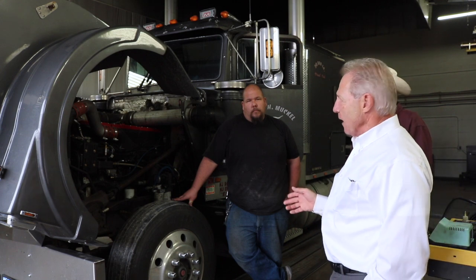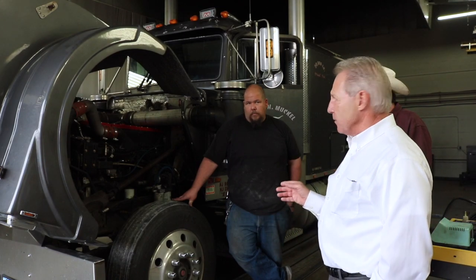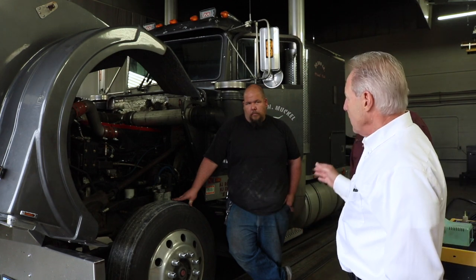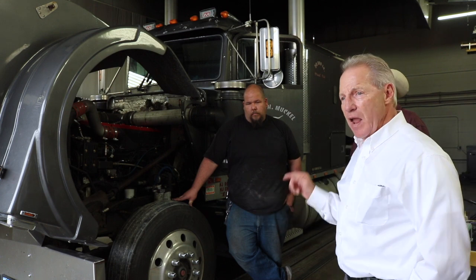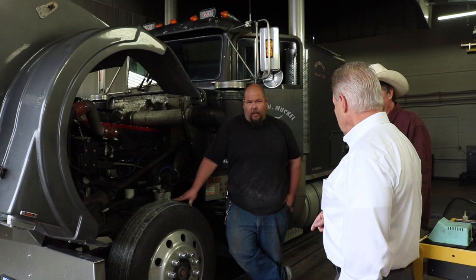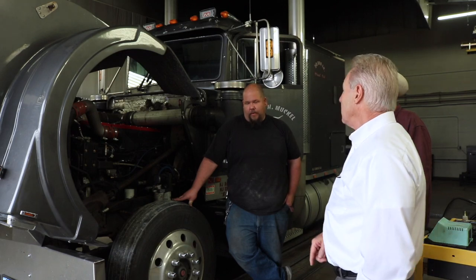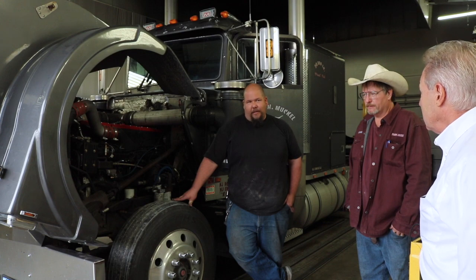Well, it had a big cam 4, no, I'm sorry, it had a big cam 400 CPL 676. It now has a Cummins Reman N14, and it's in here, and we have it on a dyno. And JR, one of our electrical engineers, is working on it because the fan is staying on. Correct? No, the ECM is not turning the fan on. There was a wiring issue, so we ran a new wire to the fan solenoid.